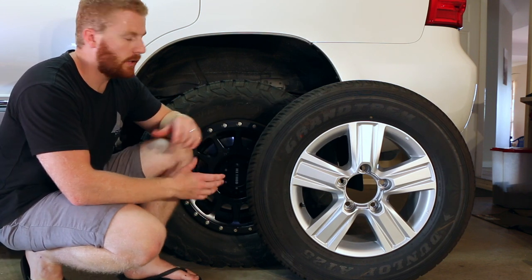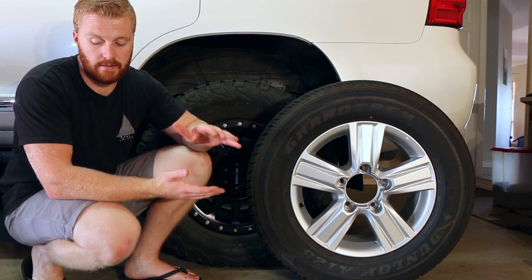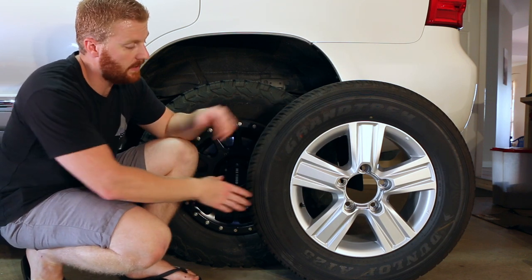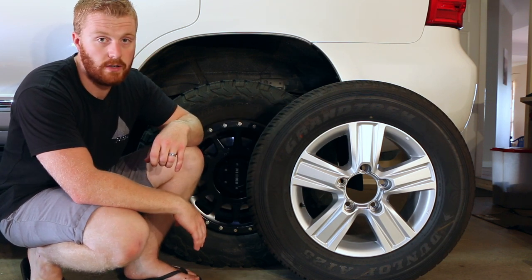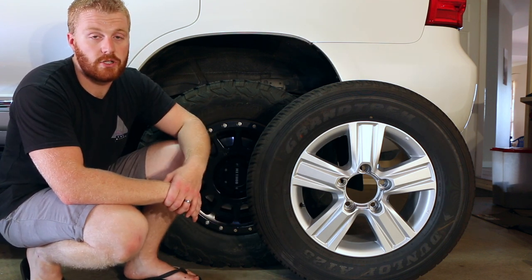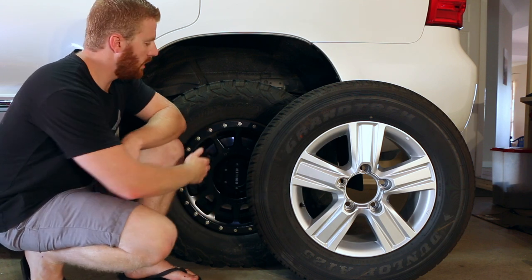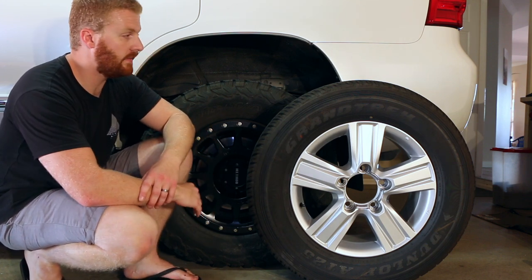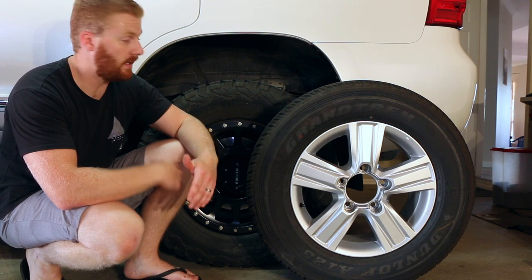What you're looking for when you're going off-roading is a decent sidewall. The sidewall on the standard tire here is 6.7 inches in height. When you compare that with the BF Goodrich, you're looking at 7.8 inches. Yes, we could have gone down to a 17-inch rim, however we're sticking with the 18s — we've still got a decent sidewall there and it's still a strong tire.